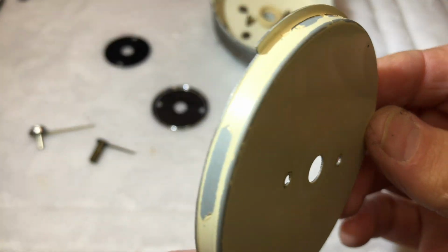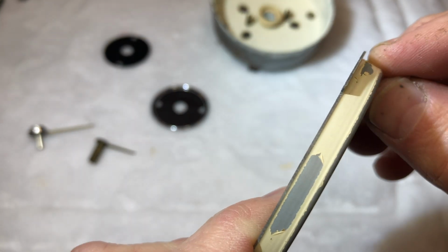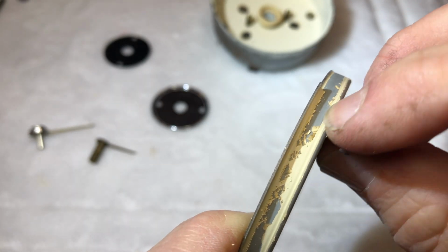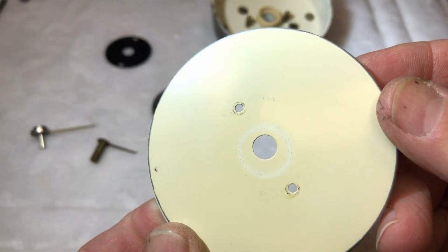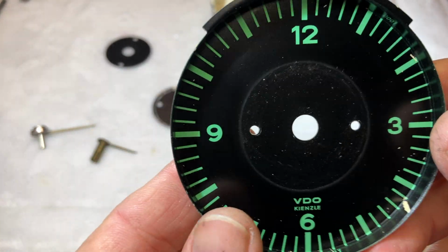Also, flip it over on the back side here. You can see paint really yellowing there, and then our edge here, all the paint flaking off. So this right here, this is why we're getting dim lights on the dashboard. What we're gonna do, we're gonna sand all that up, repaint this up in a bright silver, wax her up, polish her up, and should be good to go.